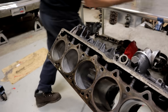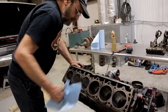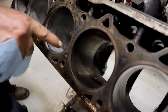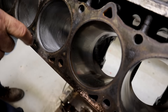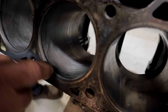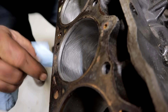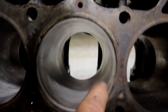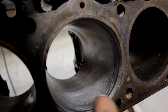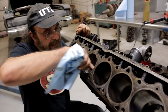Let's give that a look. Now you can see our crosshatch. I want a little more crosshatch than that, and you can see we've got a little bit of shadowing right here. But we can see that our crosshatch marks go right through, so we know those aren't really low areas. There's a typical low area just under the ridge, but again we can see where our stones are actually making contact with it, so you don't want to go too crazy with that.